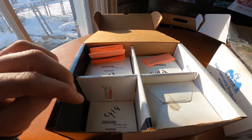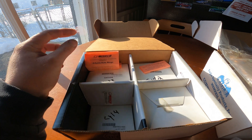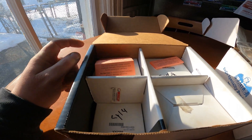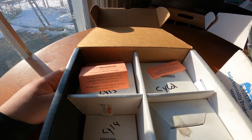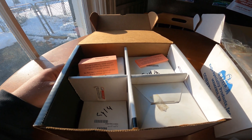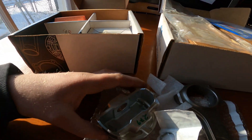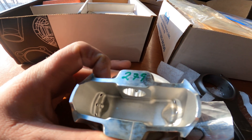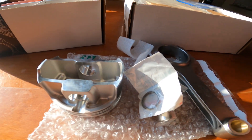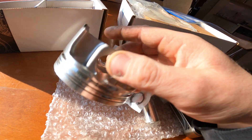These are labeled cylinder four, three, two, one. The tuner and I actually set the rings up for each hole in the bottom end - that's why these are labeled, and so is the block. You have to set the piston ring gap as per your setup: supercharged, turbocharged, or nitrous - different specifications through Wiseco for different setups. We went ahead and gapped these for a nice little boost setup - lots of boost. Also, these pistons are all weighted and balanced the same, as well as the rods, so everything should be well balanced in the rotating assembly. The dot faces forward on the piston.